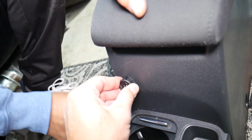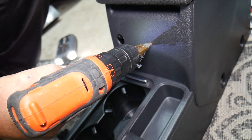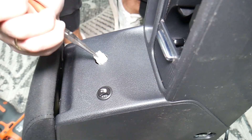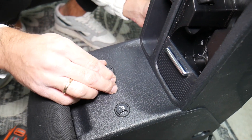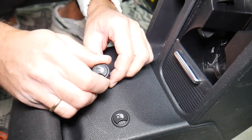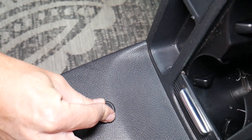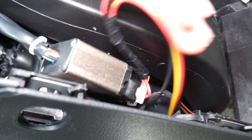We check if the switch fits and go ahead to drill the other hole as well. Once both holes are drilled, we install the switches — they go in one way only. We may need to drill a little more on the back since we're hitting the console. After drilling the back a bit more, the switch for the left seat installs perfectly, with all wires aligned inside and tied up out of the way.